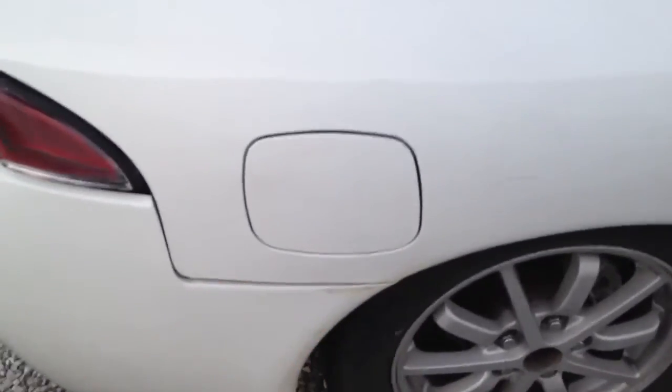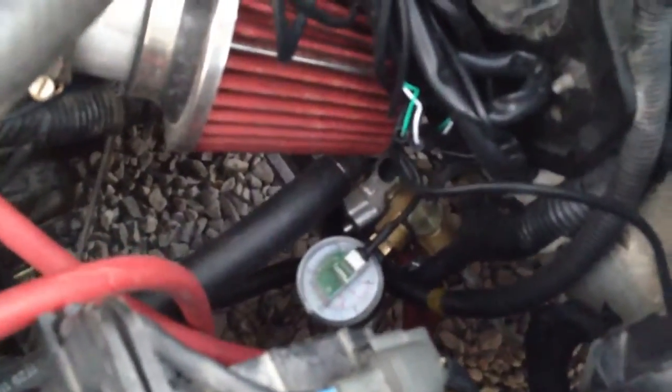I still have my standard gasoline fuel tank. There's my 4-cylinder engine with the regulator — you can see the white tubing down there, which is where it's running up from the fill nozzle on the back. The fuel regulator drops down the pressure to a usable pressure for my motor to run on.